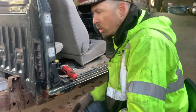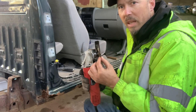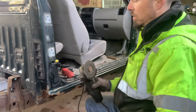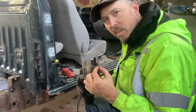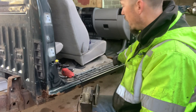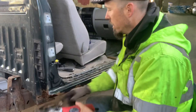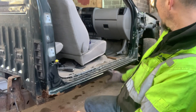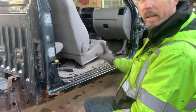We are now switching to a thin kerf blade — see how super thin that is? As compared to how thick the other one is; that's the one I was grinding all the little spot welds off with. This one, you can see the mark I've put all the way around. We're going to cut this, take it out of the way, put the new one in place, weld it back in, and paint it.